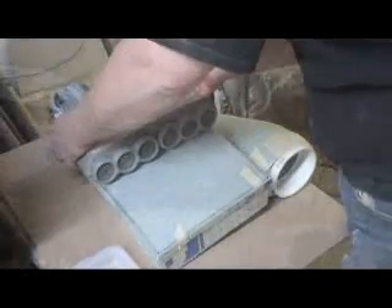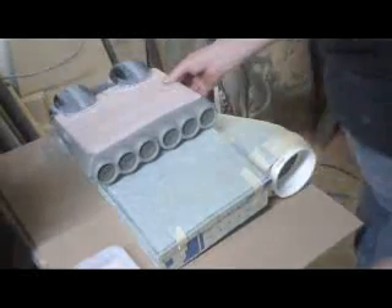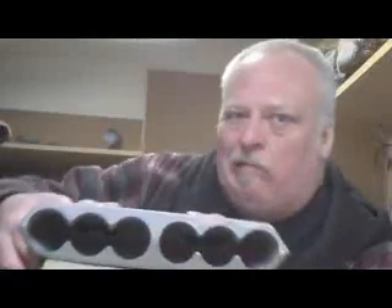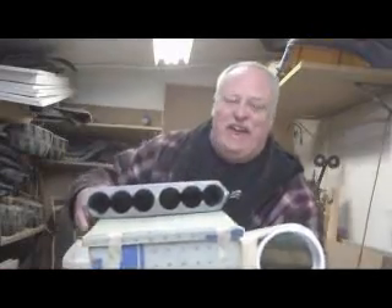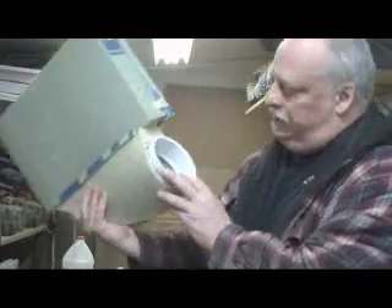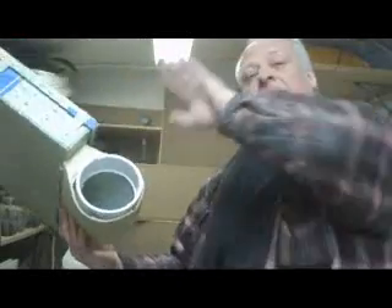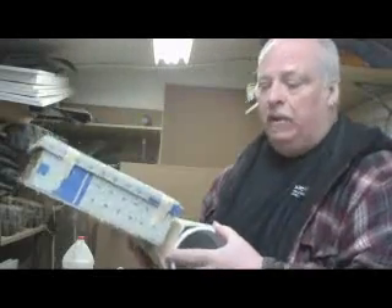I would need a larger piece to hold more weight to get it to actually break, so it is very strong. But more importantly, I want to keep the air insulated, because this is going to be sitting on top of the engine. If you're looking at the front of the car, the scoop is going to be sticking out through the hood. I'm doing the outside first, then I'm going to do the inside — I'm going to be basically porting that, sanding it — and everything on the outside is fiberglass so it's more rigid. Then the inside will be fiberglass as well.